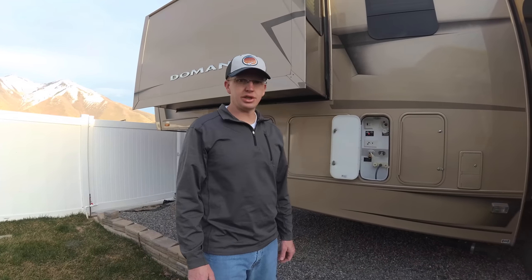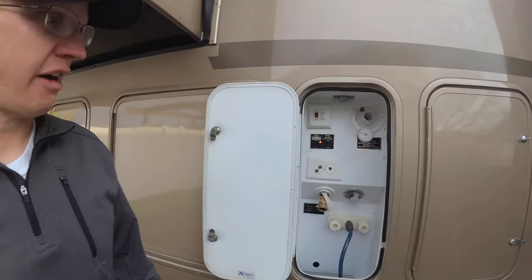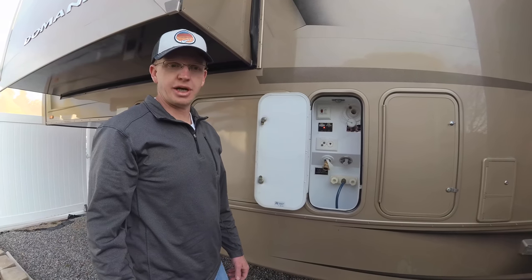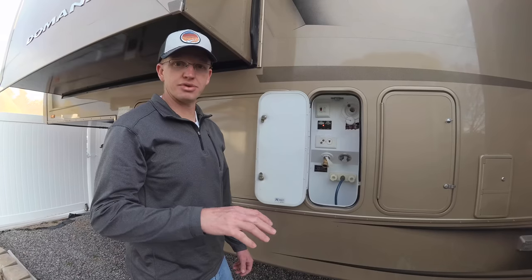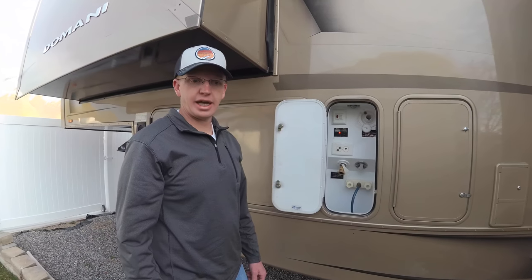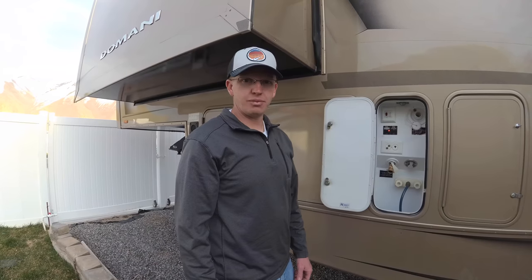What we're going to do is use some bleach. We're going to fill up the tank about halfway, then dump in the bleach. We're supposed to use about a cup-ish for a 50-gallon tank. Then we're going to let it sit for the night after we pump some through the system. Tomorrow I'm going to drive around and slosh it all around, get it weighed, then drain it and refill it to make sure nothing smells like bleach. If it still smells like bleach, I'll slosh it around some more and drain it again.